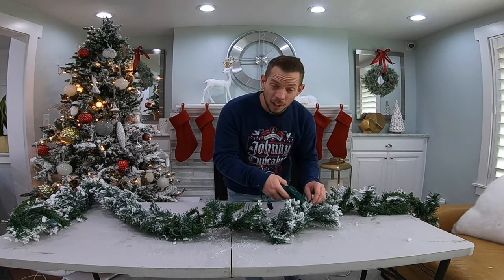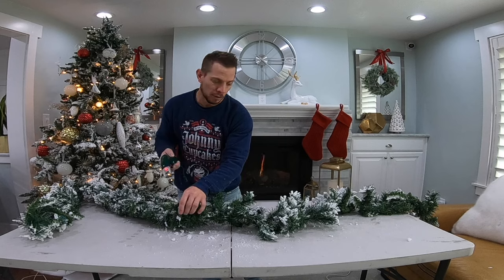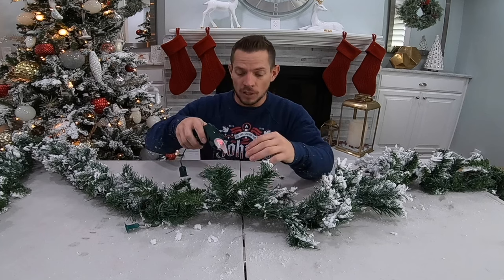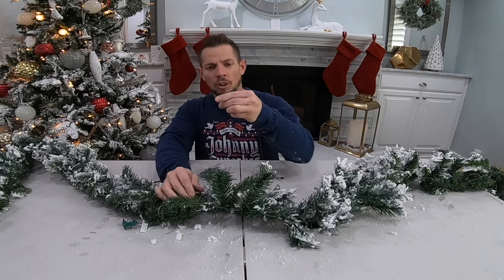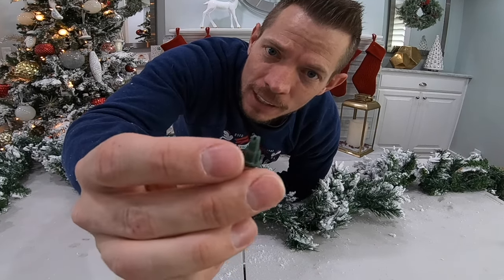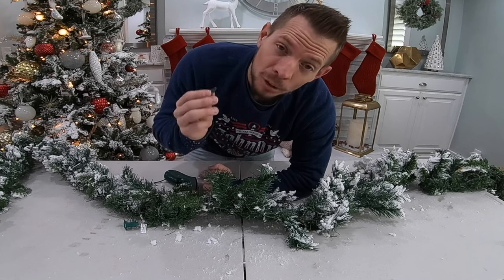As I work through all the lights with that sound, I get to a certain point — right here — where I lose it. I've unplugged this second half just to see if my problems are in the first half. As you go over lights that are good, you should get a green sound. If you're not getting a green sound, there's no light bulb there — that's where you first need to address the problem. Right there, that's one I need to replace. You pull it out and look at it. This one I can't quite tell if it's blown — sometimes you'll see a black mark inside. But this one's missing a wire. Those two little wires on each side are what continue the circuit. That's why these go out when one goes out — it's a cheap way to run lights, and a pain if you lose one.